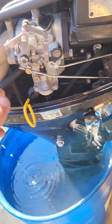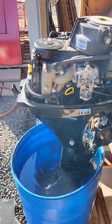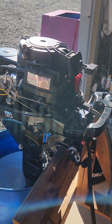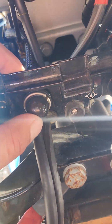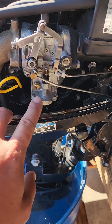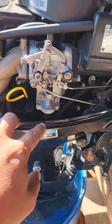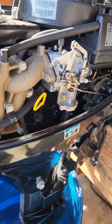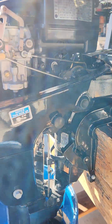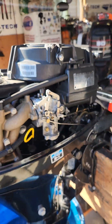The gear oil looks brand-spanking new still. I replaced the spark plugs — there was kind of a carbon buildup on them. This primer right here had cracks in it, so I replaced that. When you pump the primer, it was leaking fuel out of the bottom of the carburetor. It looked like somebody put some type of gasket sealant on it. I can tell somebody's had carb issues with this engine before, because the cap for the adjustment screw right there was missing.